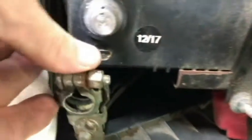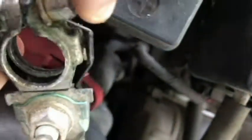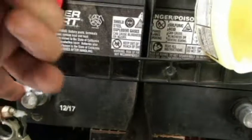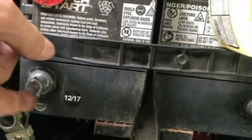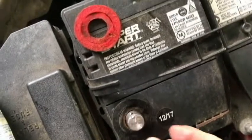Posts are clean, terminals are clean — kind of shiny. Next I'm going to take some petroleum jelly and just coat the post lightly, then wipe a lot of it off. This is going to help prevent corrosion buildup. I'm going to go ahead and put these felt pads back on — they're still in okay condition — negative on one side, red on the positive.